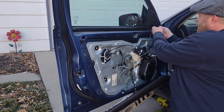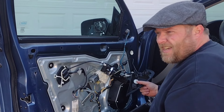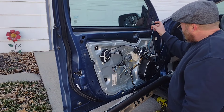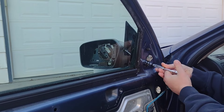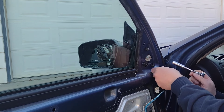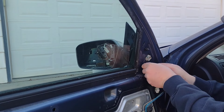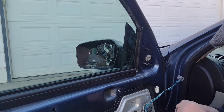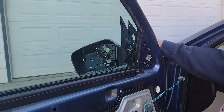The next thing you need to get out of the way is this little cover here - it just snaps on there, no big deal. You don't need to unhook the wiring or anything to this, you can just let it kind of dangle. Now we've got to the guts of the mirror here - just undo the electrical connector just like that. Pop all these loose, and now's the time that if you care about what's left of that mirror you want to make sure you've got either somebody holding it on the other side or your hand over here.